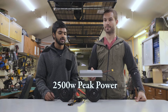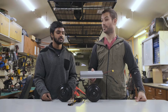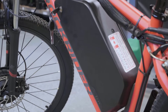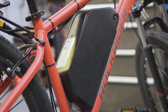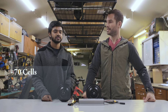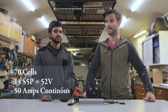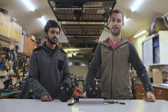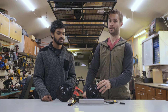With both motors you can get about 2500 watts of peak power and about 1200 watts of rated continuous power — a substantial amount. Of course you're going to need a battery that can provide that. In our case we've got a 52-volt 25 amp-hour battery with Samsung 50E cells — a 70-cell pack, 14S5P — so that's 52 volts, 50 amps continuous that the battery can provide, which more than does the job. Just be aware it does require a lot of battery to power two motors at these power levels.